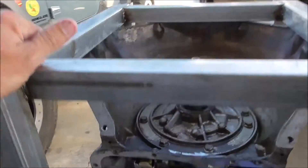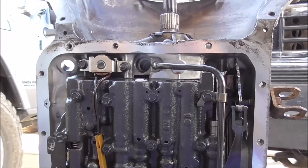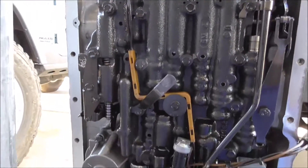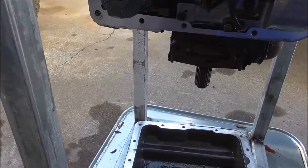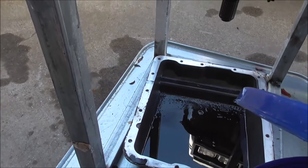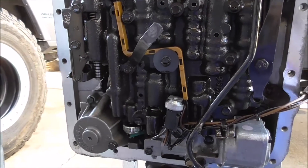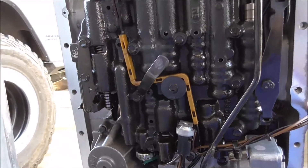What I'm going to do is start taking this apart — I'm going to lay it on its back and start taking this apart. When I pulled the transmission pan off when it was on the ground, the transmission filter was just laying on the bottom of the pan, so I'm wondering if that was my problem when I went to drive it and it wasn't shifting properly.